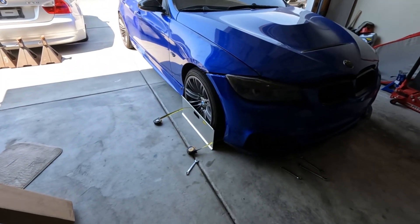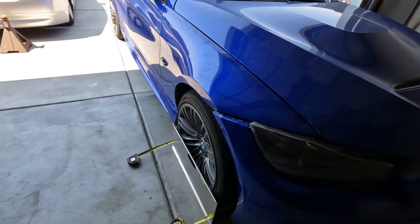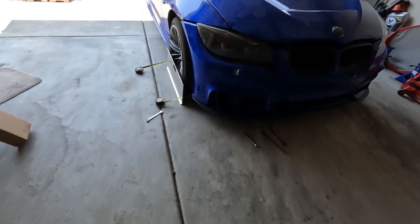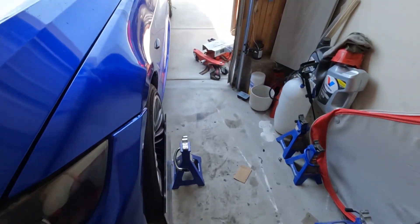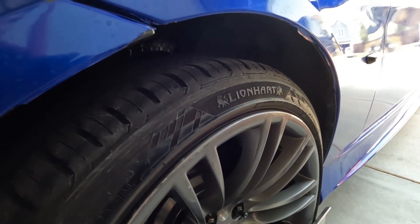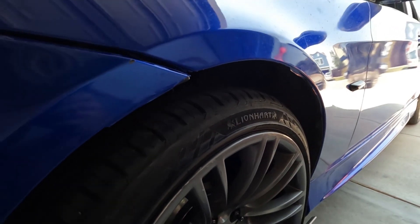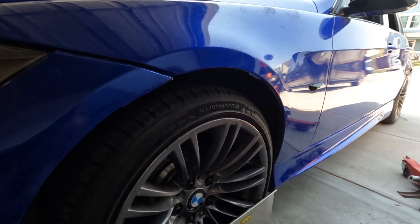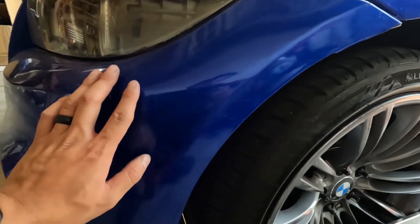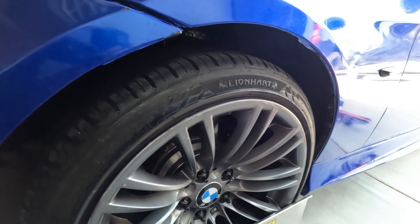I just went on a test drive — drives fine, feels good. The new angle kit feels good, I like how I'm stock-looking now, which is great. Right now I'm just doing a toe plate check to make sure I don't kill my tires. I already lowered the front coils two inches when I did everything — look how much more gap there is. I can probably drop it down way more. So I'm gonna drop it first, do a toe plate check, and then get the break-in miles in. Wash this thing too — at the last event I was driving through sprinklers and there's a whole bunch of watermarks. Stay tuned.